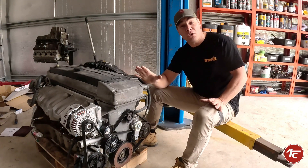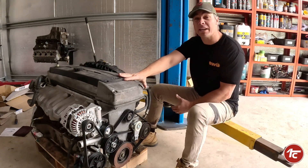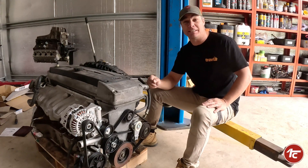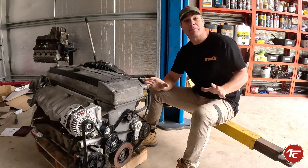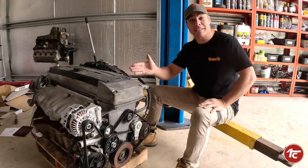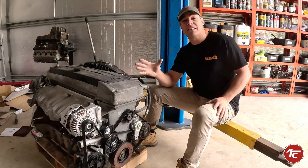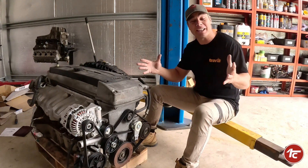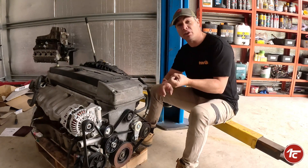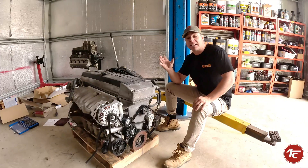Compare that to an LS — you're probably looking at a base of about five grand for the same sort of setup. We're about four thousand dollars cheaper straight off the bat. The third reason is parts availability, similar to Toyota characteristics. We can walk into pretty much any auto store anywhere in Australia and buy parts off the shelf, or get overnight delivery. It's also a straight inline-six four-litre — we're basically swapping the same style engine for the same style engine. Reliability, ease of parts, cheap pricing, and a stack of conversion parts available.